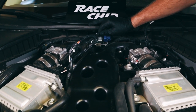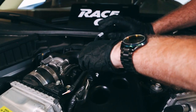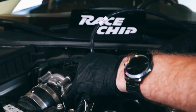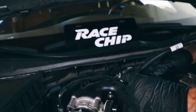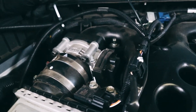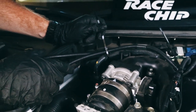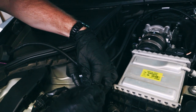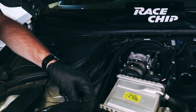Now, after installing both the A and B cable, we're going to look to wire the harness. We're going to use the supplied zip ties — try to use three out of the five for the harness, and the other two to mount the Racechip. Make sure, when you're using the zip ties to mount the wiring harness, to avoid any hot or moving parts, to not pinch any electrical plugs, or to pinch any of the fluid lines.